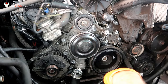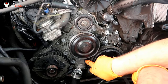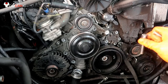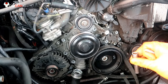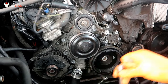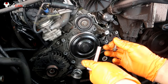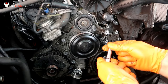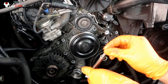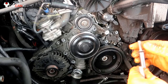One other note for this water pump replacement: right here you have an E10 bolt, and if you're using a standard socket there's really not enough room. So you either have to use a deep E10 socket, or in this case we used an 8mm socket — it's pretty close and it'll fit. That way you can remove and install that bolt.